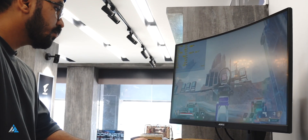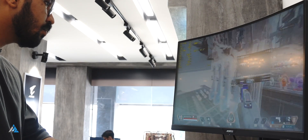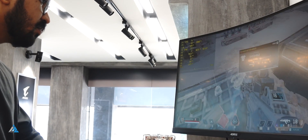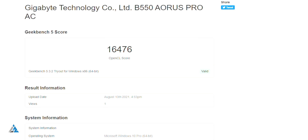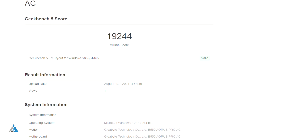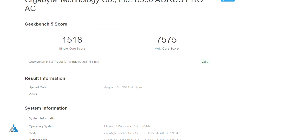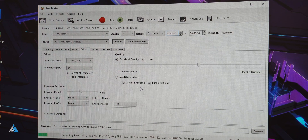So if you're somebody who's going to game a lot and don't have the budget to buy a dedicated GPU right now, I would suggest buying the 5600G now. Later on you can disable its internal GPU and pair it with a graphics card of your choice, because the single-core performance is pretty good. All of the benchmark scores showed me that compared to the 5600X there's a slight decrease in performance, but if you disable the iGPU, things even out.